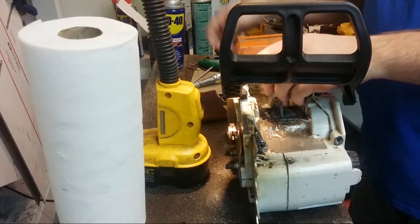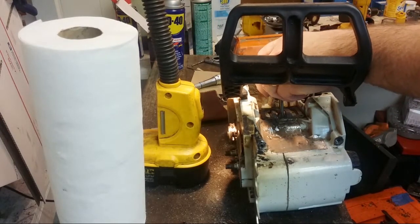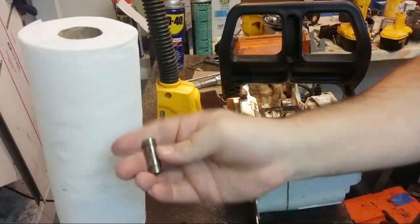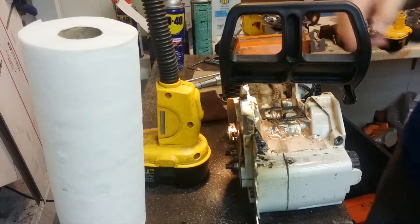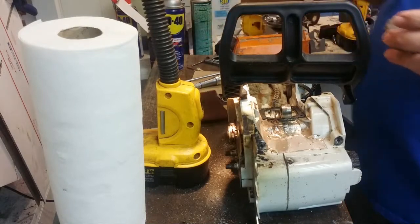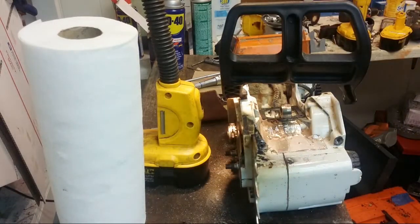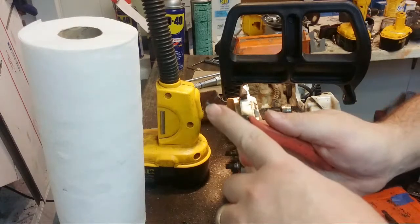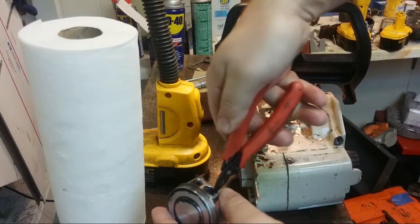Means ideally I gotta push this out. So this is an OEM 660 wrist pin, tapered pin, and it's an OEM pin bearing as well, which I highly recommend. This does not have ears on it, so these are a little harder to do. With your pliers that are half mooned out for clips, you bring it around and you dive into that spot.